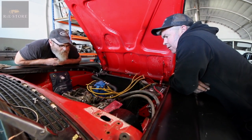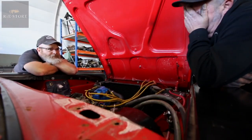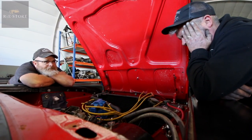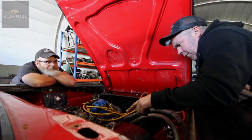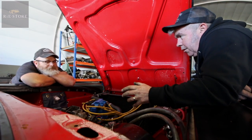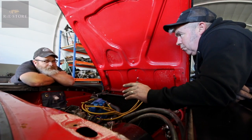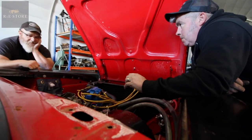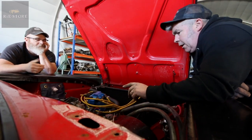I don't think it's the carb. There must be a way of checking it on top dead centre - what the valve lift should be on another piston, and that will tell you whether the cam timing is right. You should be able to set it to top dead centre on number one, then put a DTI on one of the valves and it should confirm you've got the right timing - because I did it on the Buick. You set it up on number one, bring it up to top dead centre, and then another valve somewhere should be at a specific position - 45 valve or whatever. If you've got the stock cam specs, it gives you lobe separation and stuff like that. So you should be able to pick that up somewhere - I'll have a look online.